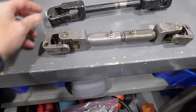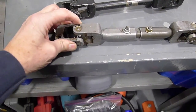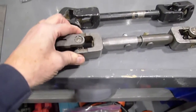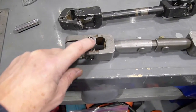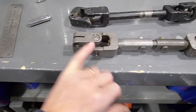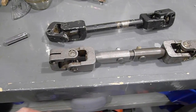You'll notice with stock Mark 1, Mark 2, or Mark 3, you rarely get normal U-joint wear, but you get a little bit of side-to-side motion as the needle bearings move in and out of their sockets. Some people don't have a huge amount of success with these staying tight, but you can — I'm just using a 9mm socket — pound down these, and then take a punch and reset the holding dents. I've done that all around just to snug it up. If you push it down too far, you can back it out by tapping it with a flathead screwdriver on the inside. Get it to where it's tight and doesn't have any side-to-side wiggle, which is much less noticeable than the rotational or torsional looseness from a worn-out joint.